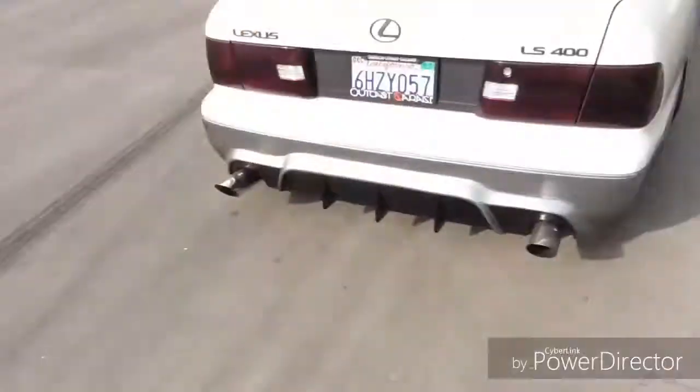Actually, I'm gonna clean up and then check for the low voltage in the trunk somewhere, see what's going on, because that has to be addressed. It's very annoying. It's been happening for a couple weeks, and every time the tank is filling and I'm at a stoplight or stopped, my remote will read low voltage. The way I know is that AccuAir will flash red going down, which is low voltage. If it went up, it's high voltage.